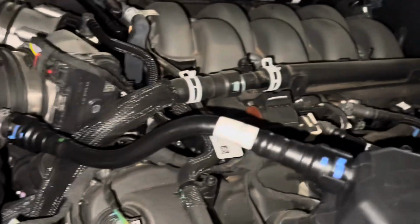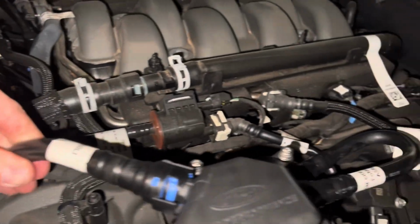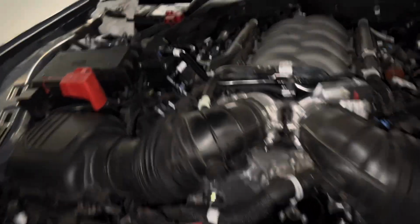Got this hose on. Careful, this guy right here, it's pretty tight. It had to take a little bit of a bend to get it in. This guy fits good, but you can see we got everybody engaged. Click down. It's pretty well seated. Retorque this guy to 88-inch pounds when you're done putting it on, just in case. So I retorque this guy, just make sure everybody's down.